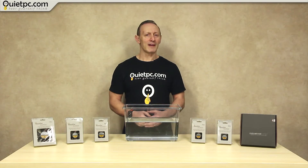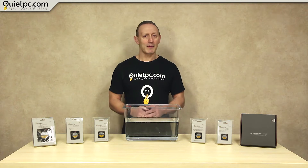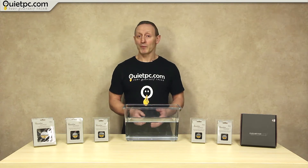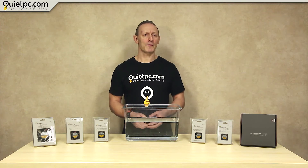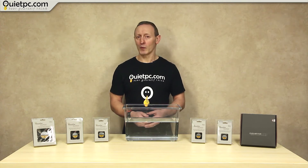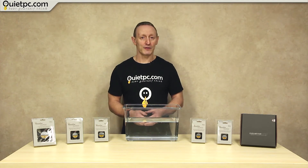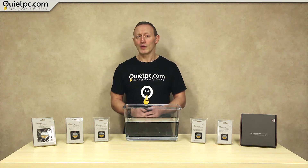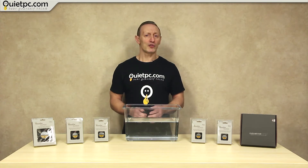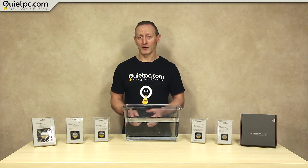Over the years I've had many phone calls and emails asking about the use of fans in dusty, damp or humid conditions. We all know that PC fans gather dust, but in an industrial setting that could be a real problem. It's not uncommon for customers to inquire about fans for use in more exotic locations such as the top of a fish tank, in a basement, or even on a yacht. In these conditions you really don't want to use a regular fan, because the dust or moisture in the air will soon get into the bearing and cause the motors to rapidly deteriorate.